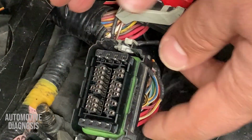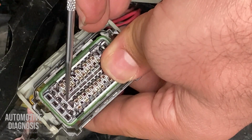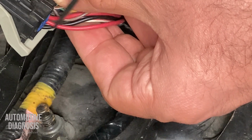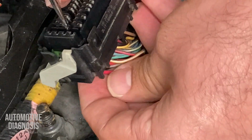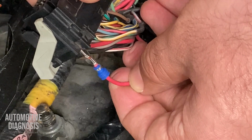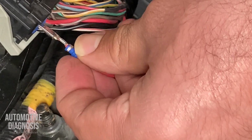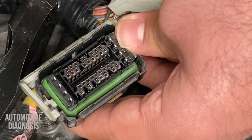And just to try it on another connector with more pins, same story, same strategy. For all these pins, I have those little tabs over there. If I grab one of them, like the second red one here, it's going to be the second one there. It's got the little tab as well. So I insert this one to release the tab, and I can release the pin from the back. Same story. It's got those little ridges here for the tab, and all good. Done. See, super easy.